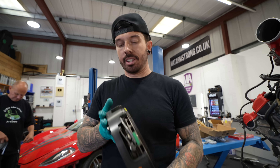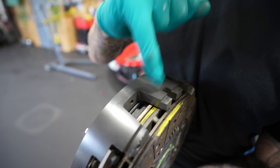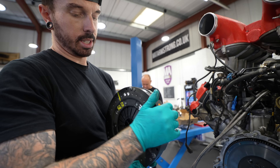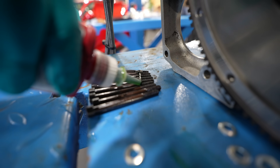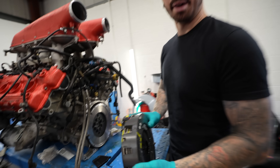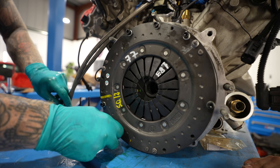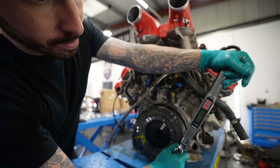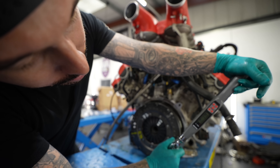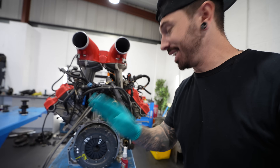This is a twin-plate clutch with one clutch plate here and another there — presumably for smoother gear changes. All new bolts with a little loctite applied. There's a line on the clutch which we assume lines up with the corresponding mark on the flywheel, since that's what it's been balanced to. Once aligned, we bolt everything together and torque all the bolts up. It's looking pretty good.